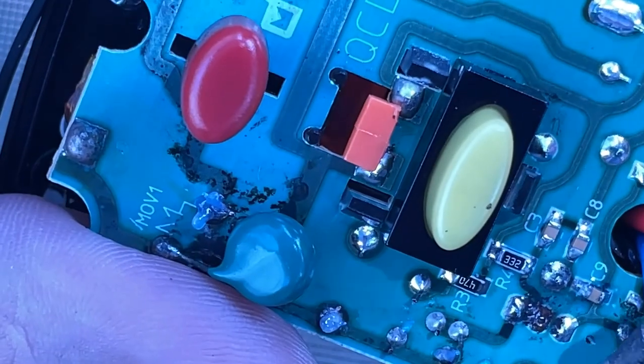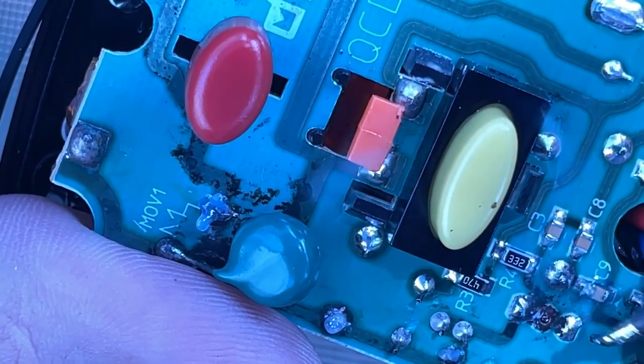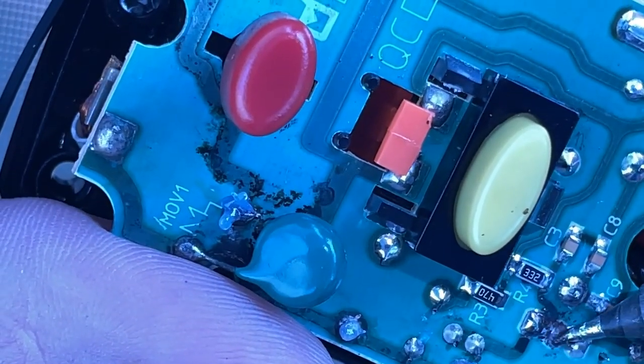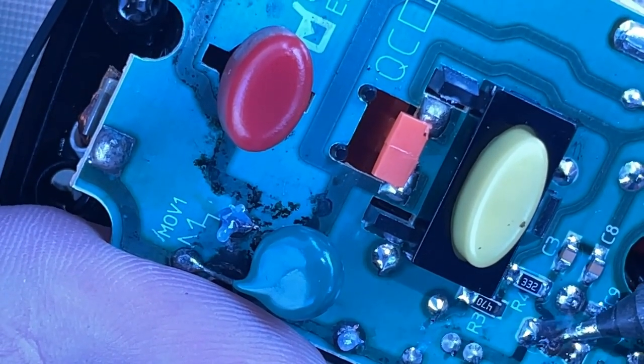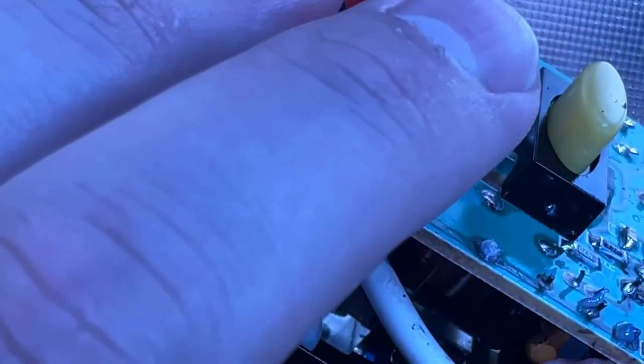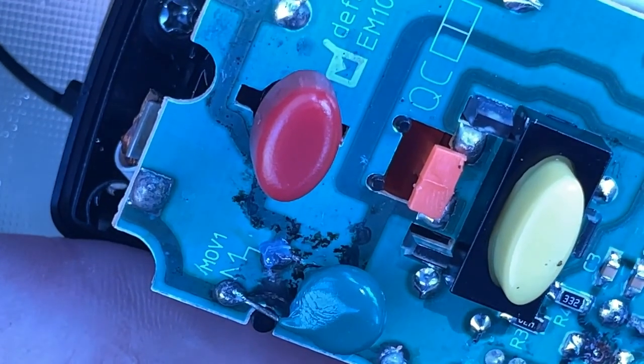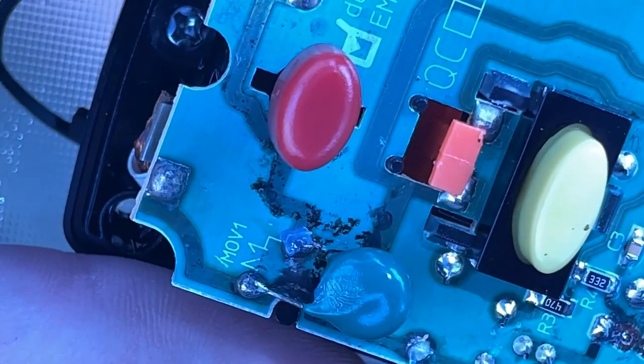We'll have to take a little bit of a... something is making a funny sound with that. That may actually need more solder. So that's actually one of the pins of the IC that I believe is causing a lot of the issues with this. One of the pins of the IC looks like it's completely not connected to anything anymore. I think it's not connected at all.